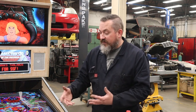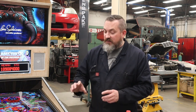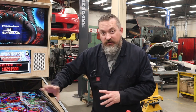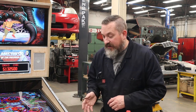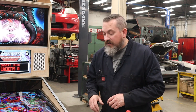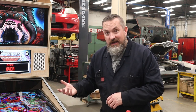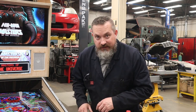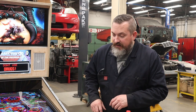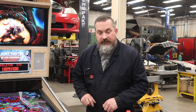So for example, wiring, if you had some pretty nasty runs of wires everywhere, this is a chance for you to clean that up and start putting it into some nice wiring looms or some channels for wiring. We also need to install a grounding wire or a grounding strap for all of the external metal components so that if something was to happen and a live wire was to touch something in metal on the inside of the cab, you don't electrocute somebody. So we need to run that and finalize all of our stuff in here and make it look absolutely beautiful inside to show off to people.